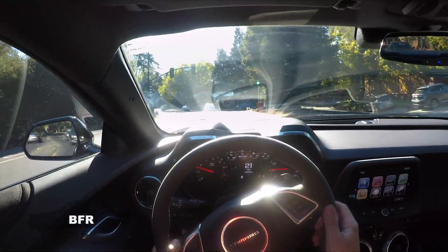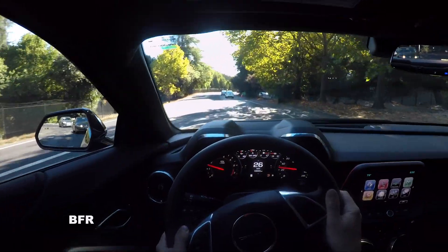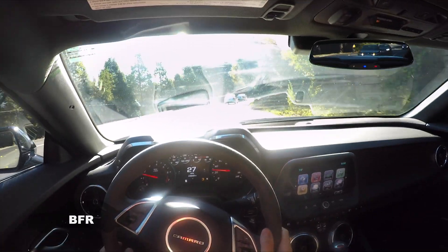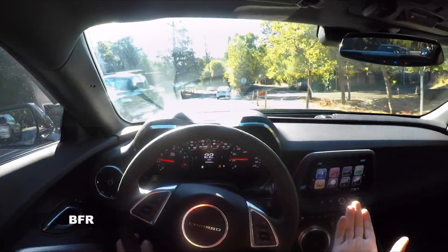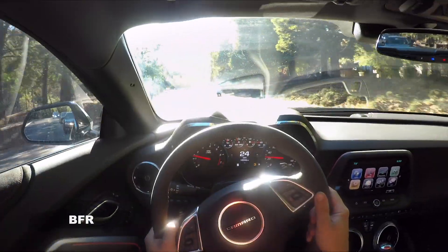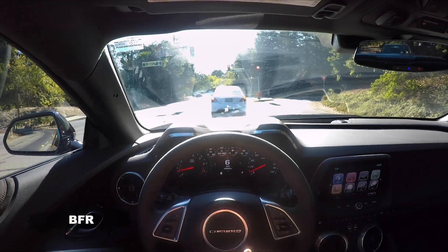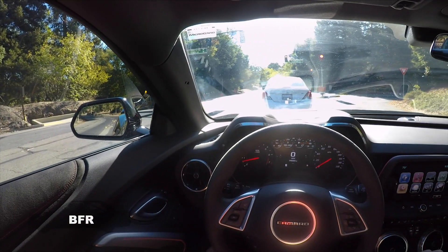While I'm going slow in traffic, let me talk about the numbers. This car weighs about 3,850 pounds on the scales and dynos in at about 565 horsepower or so, giving it a weight-to-power ratio of about 6.8 pounds per horsepower. Mustang GTs are around 8, and my E36 M3 was at like 13 — meaning 13 pounds for every horsepower. So you want a lower number, and this car is at 6.8 in realistic terms.